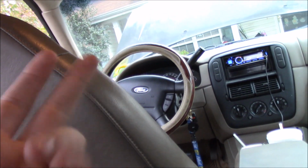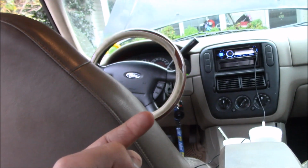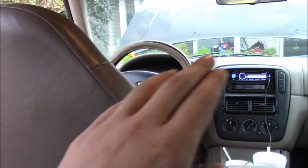Well, there was an amp wire. There was 2 blue amp wires, and we ran that third one down through the dash and out through here, and obviously into the amp, right? Well, we did that the first time, and we were getting these really raspy sounds out of these speakers right here. So what we did was we disconnected the one coming from the car. Okay, not the one going to the amp, and not the one coming from the radio. The one coming from the car. So whenever we connected those, we got rid of that raspy sound, and everything sounded fantastic.